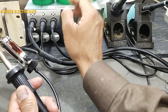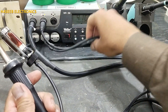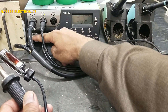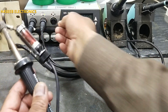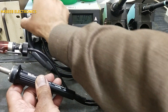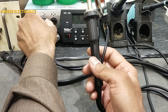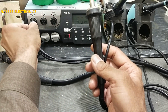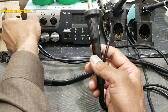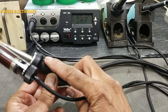We can see it has three channels: one, two, three. This is the soldering iron, here is the desoldering gun — this is vacuum and this is air. In my case it is working. The first step to verify it: remove the electronic control from here and connect it to any one channel — we can connect to channel one or three. Install it there.